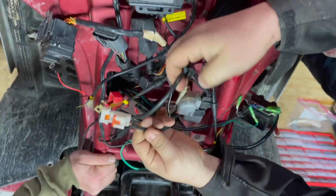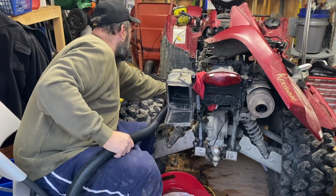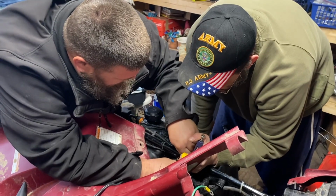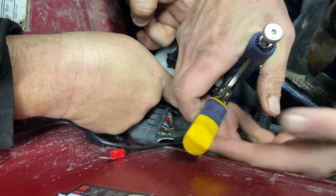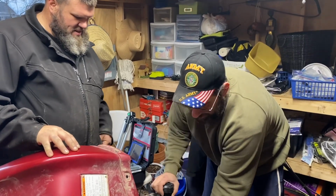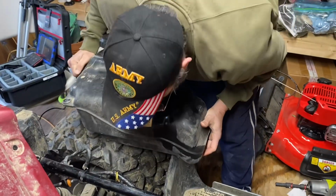Other than minor issues, electrical stuff is where I punt. While Curtis is taking a look at the electrical system, I move on to other necessary maintenance. Whenever you take your girl through the mud, as in trail riding, you sickos, you need to clean her up as soon as possible. But that's not the only issue I have to address. With a little help in the beginning, I'm going to replace Roxanne's fuel pump. Suzuki King quads, both 500 and 750s prior to the year 2019, have notorious stalling issues. Those issues are usually fixed with an enhanced grounding system, or by replacing the fuel pump.